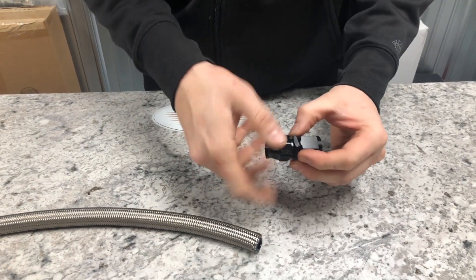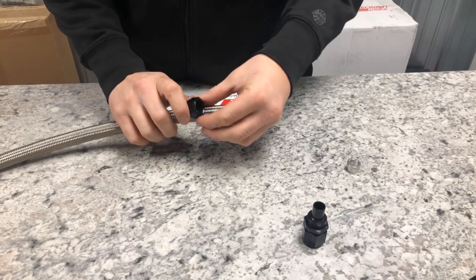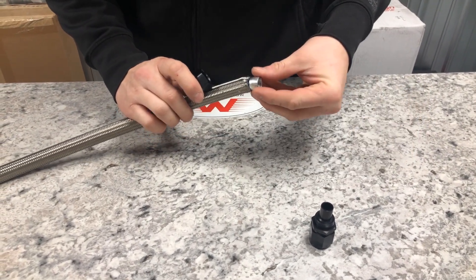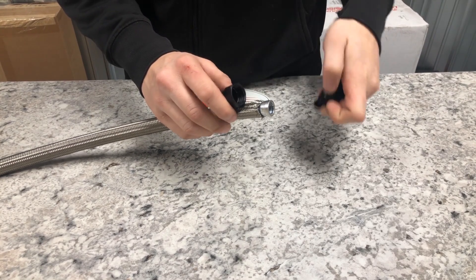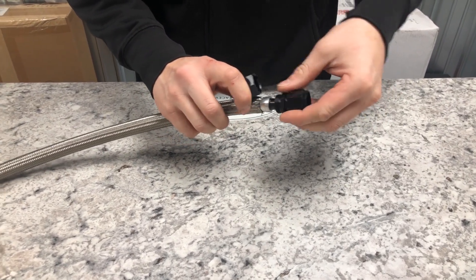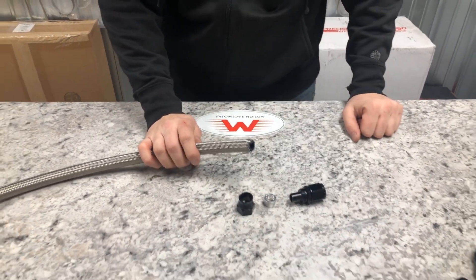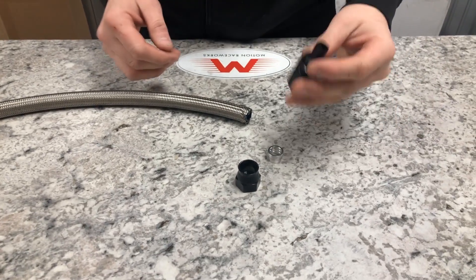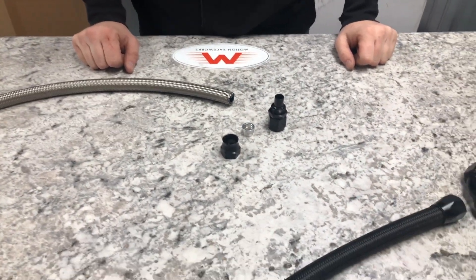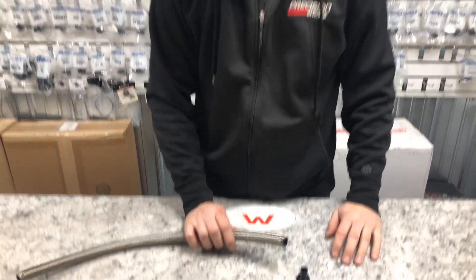PTFE hose uses a different fitting — it uses what's called an olive. After you make your cut, the olive slides onto the hose and sandwiches between the actual PTFE and the stainless braid. You bottom that out, the fitting slides in, and it creates a sandwich seal. The biggest downfall to PTFE is it's extremely more difficult to put together — getting your cut right so everything slides on properly requires a process. For a beginner it can become extremely frustrating, and the stainless braid pokes you in the fingers, which is unpleasant.